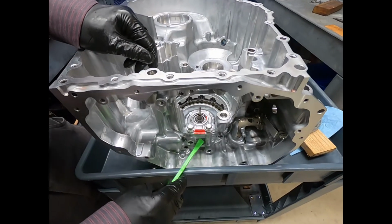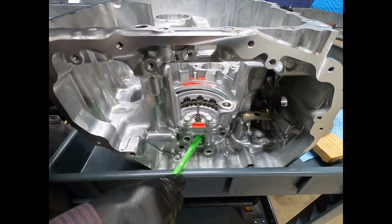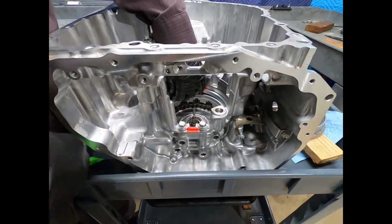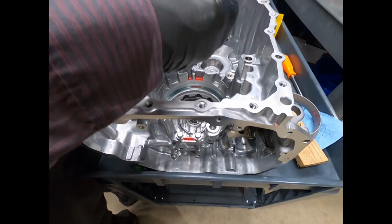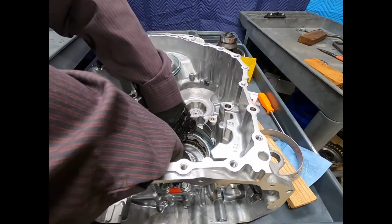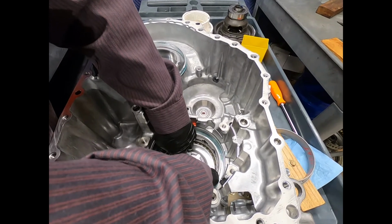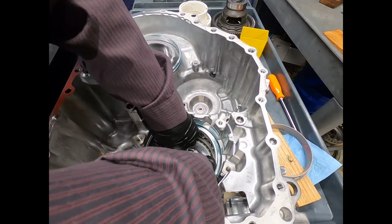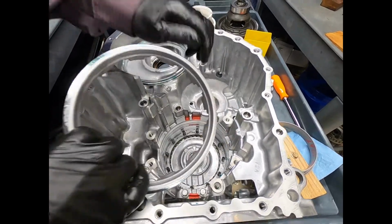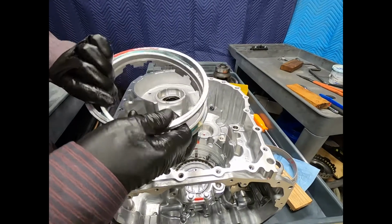Okay, here I'm using a combination of the twin trim tool with this port here on the side to carefully separate the housing from the piston. And once I do that, it is much easier to slide it out. And again, what am I fighting? Well, what happens, there's an O-ring on this, and the O-ring wants to get caught there in the case.